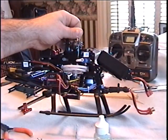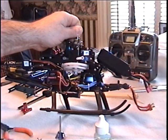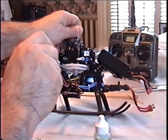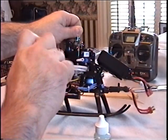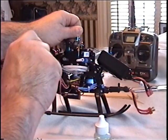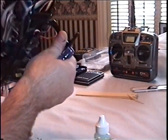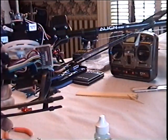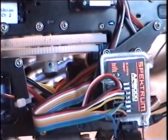See the hole for the bolt sticking out. And what you do when you come back up, you just bring it up slow. Till you think you're close, get your bolt back in. I don't worry about the collar up above till you get the head on. Okay, also flip the bird around. I took a toothpick already and dabbed the nut with some Loctite.